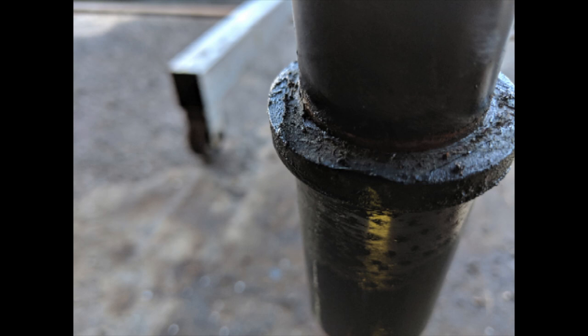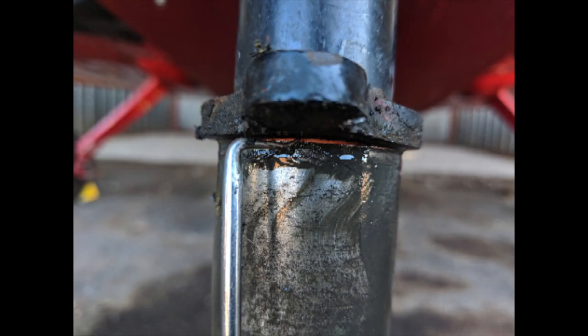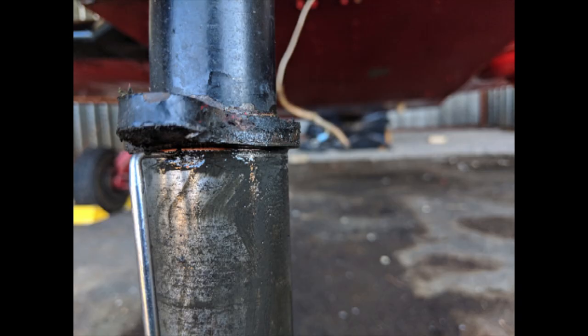The spindle looks a little deformed on the top, but as you look around to the bottom, you can see where a mechanic can slip and actually pick between the de-bonded spindle. You can see the copper from a previous weld, which affected the heat treatment of the metal of both the strut and the spindle.